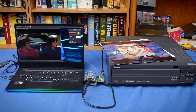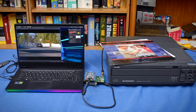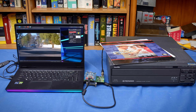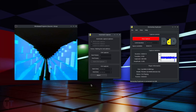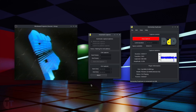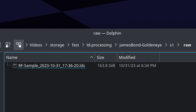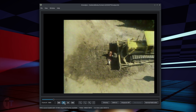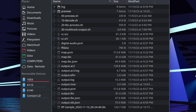Now, because this process is piggybacking off of the test point for the laser, the capture has to happen in real time to the video playback — it is not possible to make it happen faster. You should really try to make sure you over-capture with extra data at the start and end of the signal to get the proper start of the program through to the end. If you don't, you can have issues when decoding later from the missing data. As long as you keep all that in mind, the Doomsday Duplicator software is very easy to use. You can change your output folder in the settings, but that's really the only thing you should ever need to change. The LDS files you get from this stage of the process are considered to be your master backups, even if compressed. These can't be played yet and we'll cover how to get to that point in the next video. But if you're looking for the most complete file to archive for your laser discs, these are what you want to save. Everything else can be derived from these and as the software improves in the future, you may get better results from it.